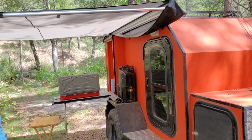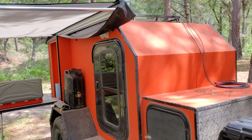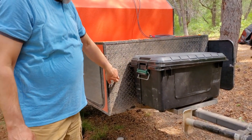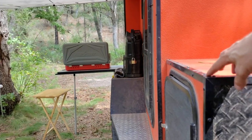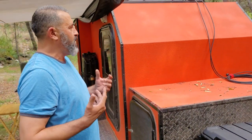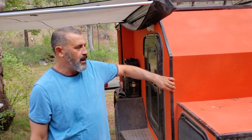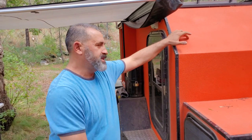There have been some alterations since the initial build. This detail on the end and this front plate were added because rocks were causing dents. The aluminum plate has fixed that — no more dents. Additionally, the vibration and flex were causing small cracks where two plywood pieces met at the corners, so I applied silicone and aluminum angle trim to cover them and make those seams waterproof.